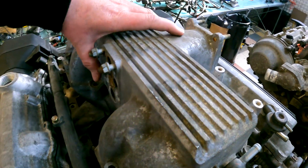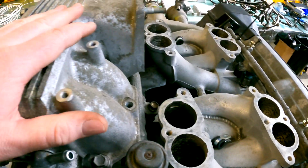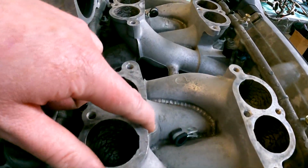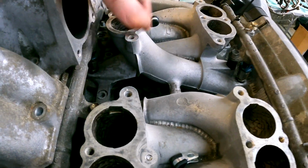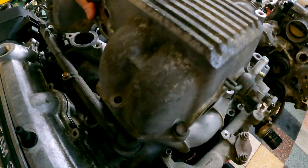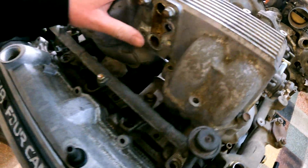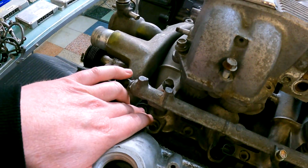And so basically, there she is. You pull the top of the intake off and you can see the bolt holes there, and that is where that harness lives. So you do have to take the top of the intake off. If you're 95 to 96, to get into the actual V-bank, to get that harness from underneath out, you don't have to. You've simply got 10 bolts.